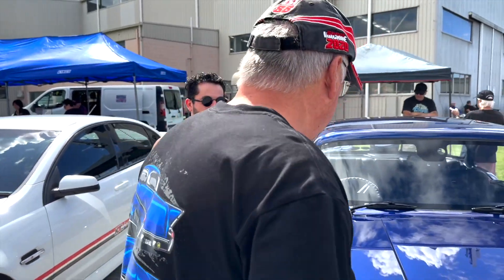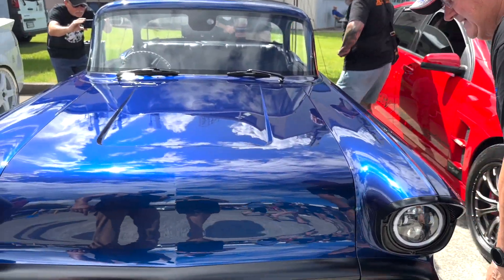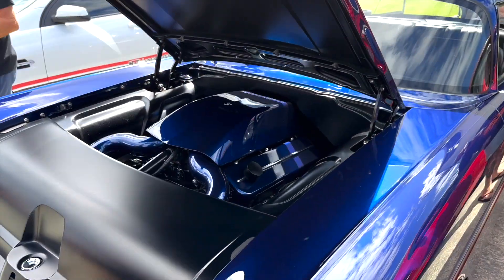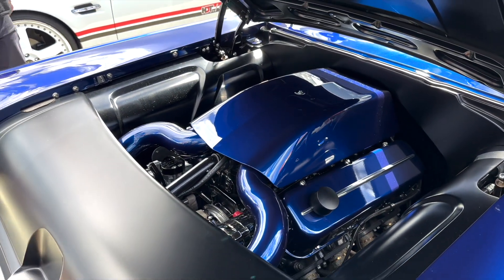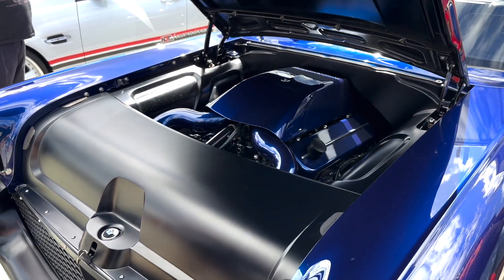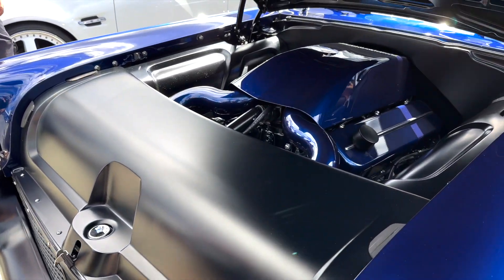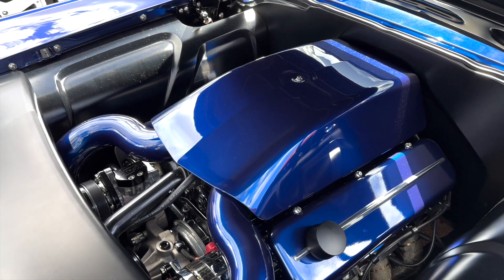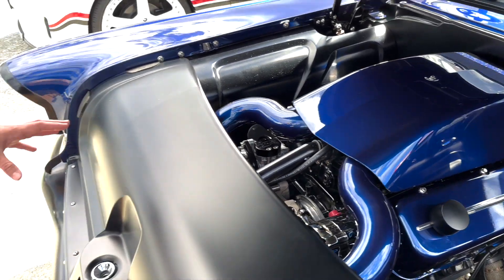Can we have a look under the bonnet? Oh, you put your windshield wipers back on - sacrilege! Here we go - look at that. So as I said before, 486 cubic inches of big block Chevy, naturally aspirated, Holley Terminator fuel injection system, Edelbrock Performer heads. We made our own headers, and PWR manufactured the radiator - it was designed specifically for this car.